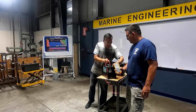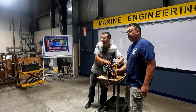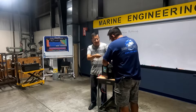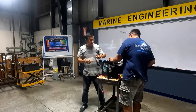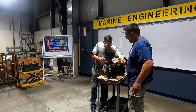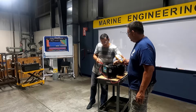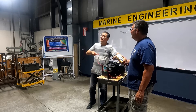And in between the last one and the second cell? 2. If you go up, up, up, at the end you have 12. It's because each cell is connected in series with the other one and the other one and the other one. For example, in between the last terminal and this cell? 9.7. And with this one? 12. You see? It's going up, up, up. You add it. 12.